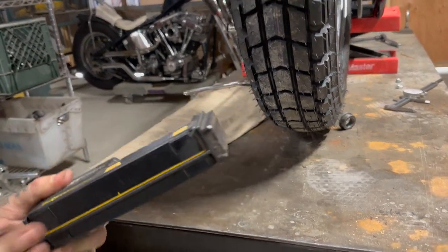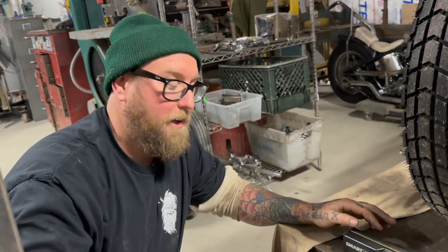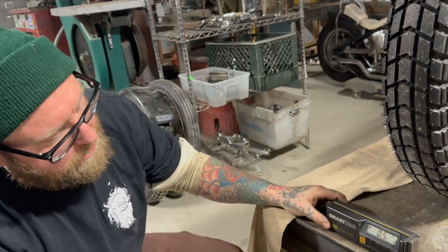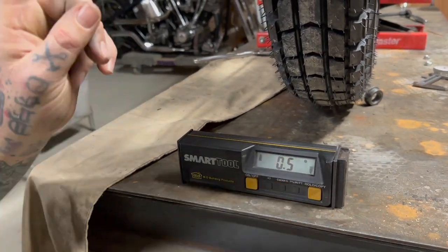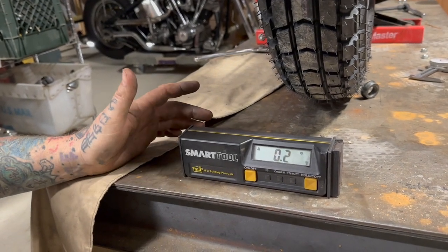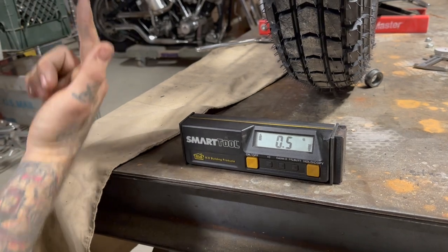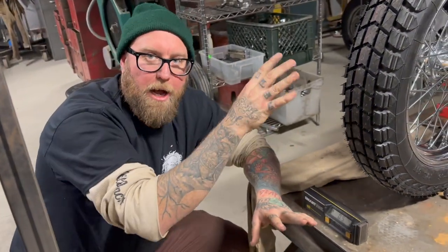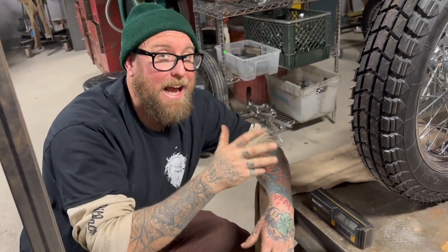So my floor is not gonna be level. We actually did the concrete in here, and I saw the dudes that did it, so I know it's not perfect. It's all over the place. But what I do is, say here I am, this is showing that it's like this. I'm 0.5, I'm half a degree up over here, and once I know that, and this is where like other crazy fab stuff that I do, I'll just make everything a half a degree off the other way if I'm trying to be that anal.